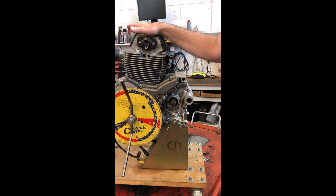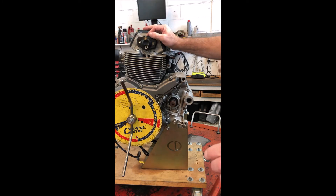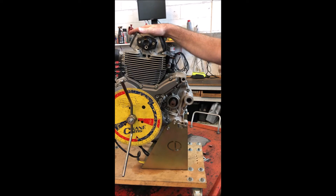In about 2005-2006 they made the journal on this end of the camshaft a bit narrower, and if the belts are too tight — particularly on those engines — when they get hot they make a really horrid bearing noise. It's like a bad alternator or water pump bearing in a car. It's just one of those noises that makes my skin crawl, which I assume is the camshaft actually running directly on the head if it can push through the oil film.